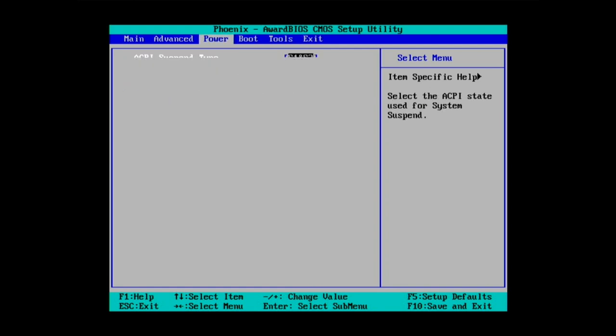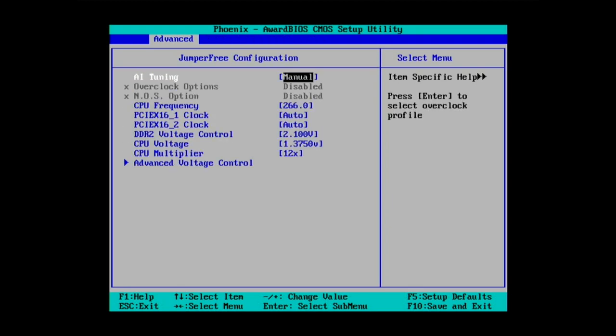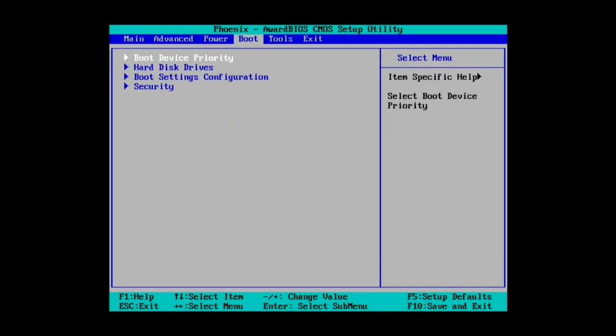So essentially, we can install Windows now. But yeah, this motherboard had me running circles for almost a day, because I didn't realize that there was overvolting of the CPU, and that had such a big effect. Usually a little bit of overvolting doesn't do that much, but on this CPU the difference is quite big, it's quite a hot CPU. It was a core meltdown basically, which triggered the system to shut down during Memtest86+, which is kind of annoying.